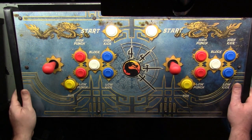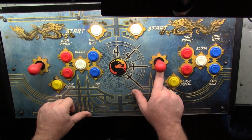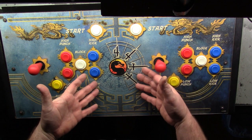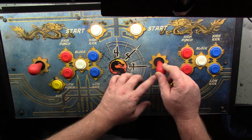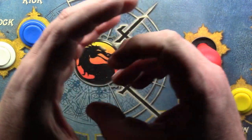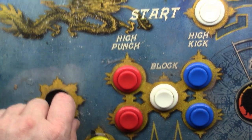So we're just going to concentrate on the top part. These are the IL sticks as opposed to the HAP. The original stick on player two side was the HAP one with the smaller shaft. I did not want to have to take all the buttons out, the Lexan off, the control panel overlay off and all that to change out the dust washer. So I kind of had to hack it up here. You can see it's all hacked up in a square — I had to get the joystick through the smaller radius dust washer. And you can see dust and contaminants underneath the Lexan.